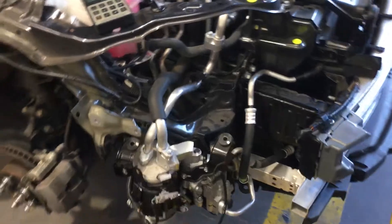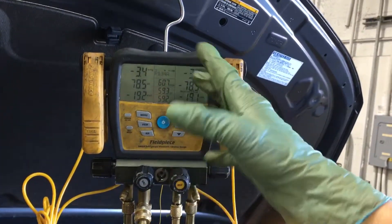This is a 2018 — it's pretty new. I'm letting it decay and seeing how long it takes to decay. I already went past the negative 15 mark. I know there's a lot of refrigerant by the freezing in there.